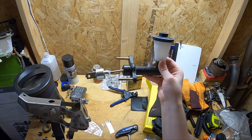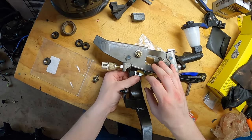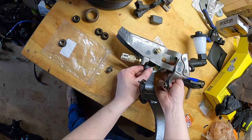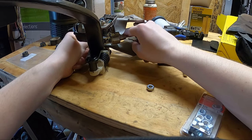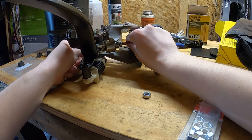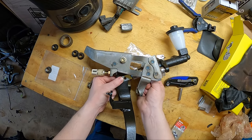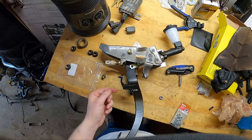This will be attached to the firewall and then it slides through here into this piece. That's almost perfect. If you're in the car, don't tighten this nut down all the way - if you back it up you can move the stud itself so you can align it. I'm just twisting the stud to align it perfectly where it's supposed to sit. That'll get you in the ballpark and then you can do minor adjustments later.